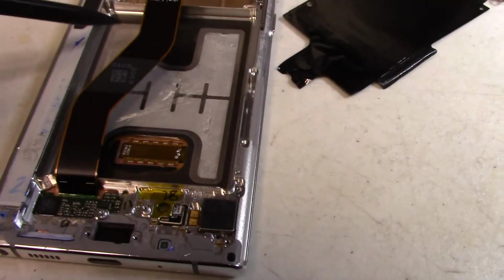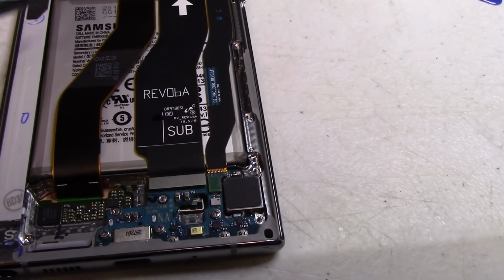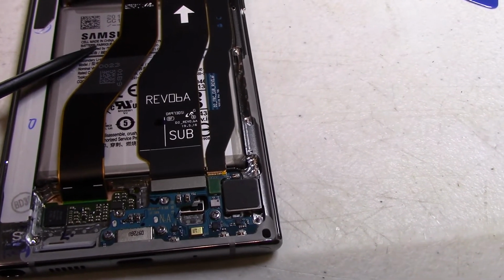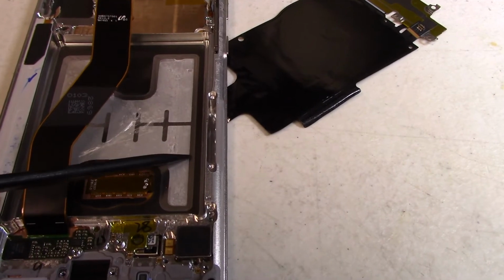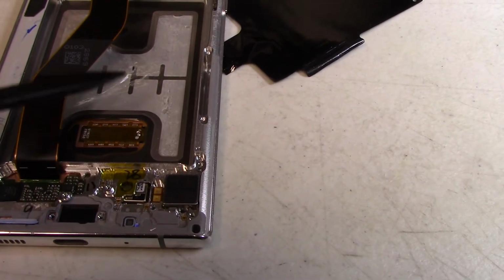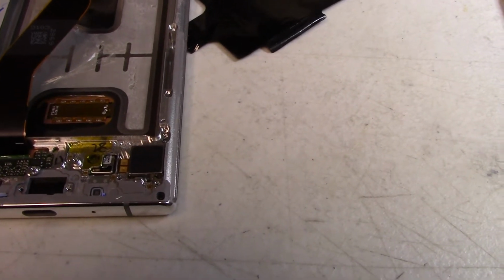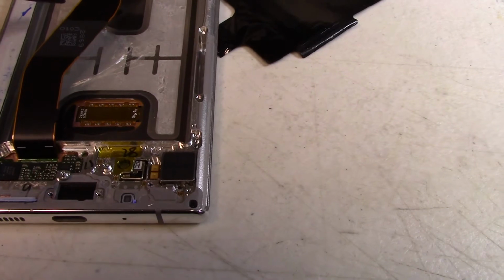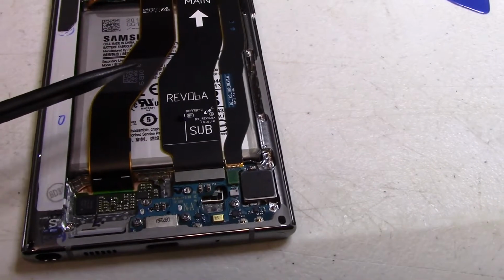It's supposed to have some machine learning in here, so that probably increases the cost of the screen, definitely, because there's a sensor here and there. But at least the USB-C will be fairly easy to take out. The battery is an issue. If you had to change the battery, and it's your first time, it would be really tricky to get at it. You would need a lot of very strong isopropyl, over 90%, and just pry and wiggle, pry and wiggle. I don't know if that would damage this. I don't think alcohol would damage the circuitry in there, but it may be more sensitive and more prone to damage than before. So this battery design is not exactly very good.